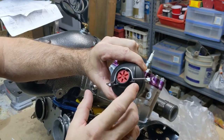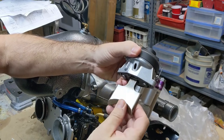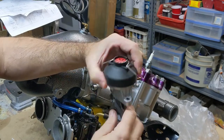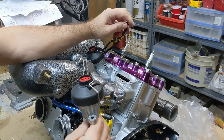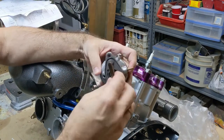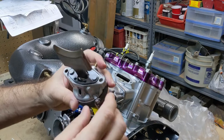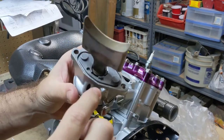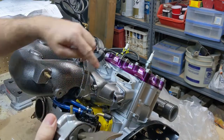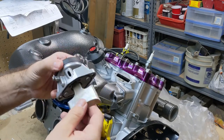On the 951s the ring is all the way down; on the 787s it's flush with the top - that's just a starting point. Once you get the engine running and doing some tuning, you'll turn those accordingly. This engine has external hoses that go to a solenoid that ultimately goes back to the crankcase underneath - that's where it gets its pressure from. In later models, the pressure comes right through the engine. There's a little hole right here, and if your valve bodies don't already have it, you can drill a hole through here, cap that off, and get pressure directly through the engine that way.